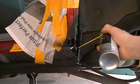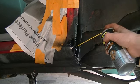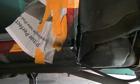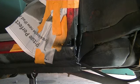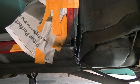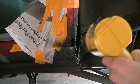I also sprayed it — there's a little hole in the rocker panel which you can't see, covered by this plug here, and I also sprayed a bunch of this in there. I did have this car rust proofed years ago, and I really need to get it done again. I should probably get it done before winter if I can. Spraying this in there sure won't hurt, and I got a heat gun to speed along the drying process a little bit.